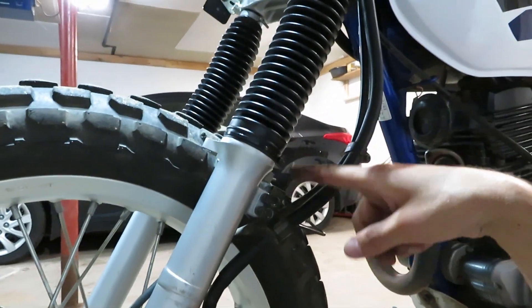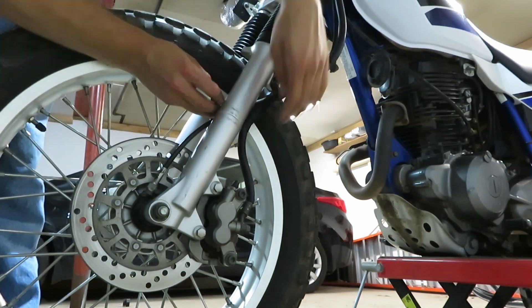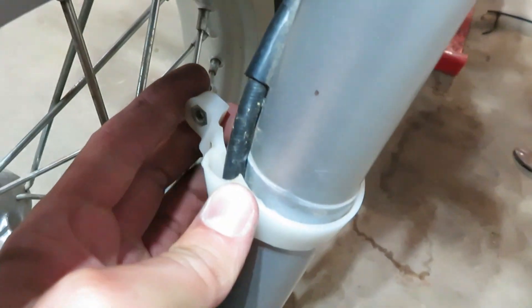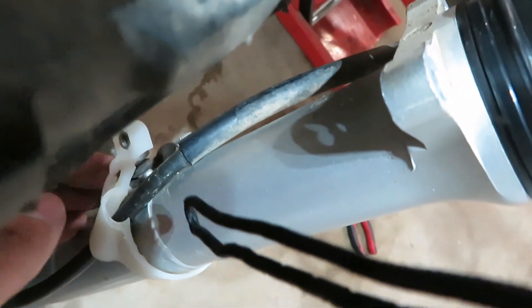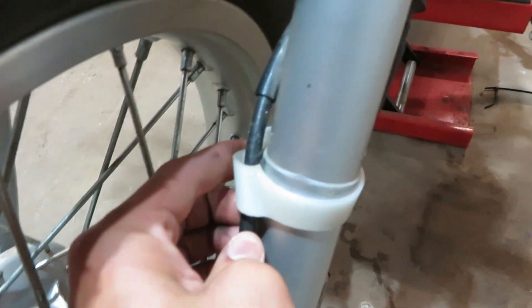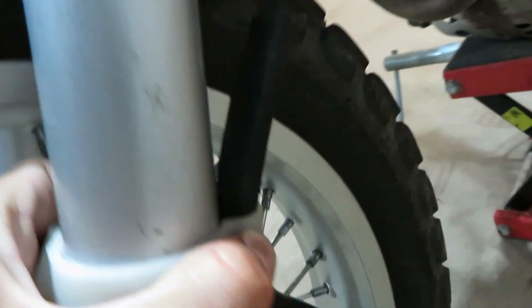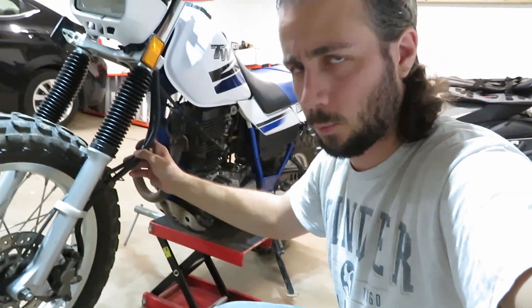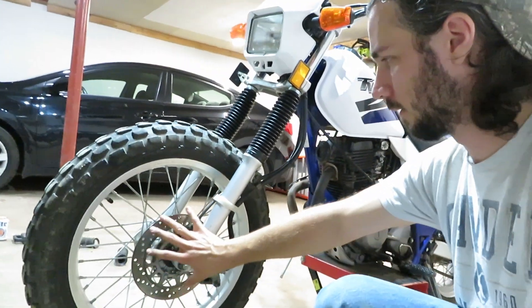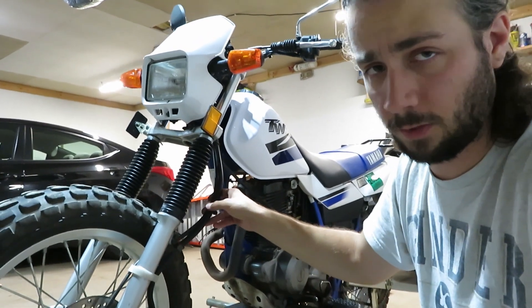So then I've just got some bracketry to put back here. There's actually a pin that goes inside of the hole there that's going to be just behind your speedometer cabling — kind of see it right there — so that's got to all get lined up. It goes through the pin and it's kind of just resting on the top of this rib there. Then your brake line runs to the back side of it. The reason you've got all this bracketry down here to hold everything sort of in place is because when your wheel goes over a bump and the shocks are compressed, this stuff all has to have a place to go that's not going to get wrapped up in the tire, and hopefully not thrown too far out on the trail to grab a branch.